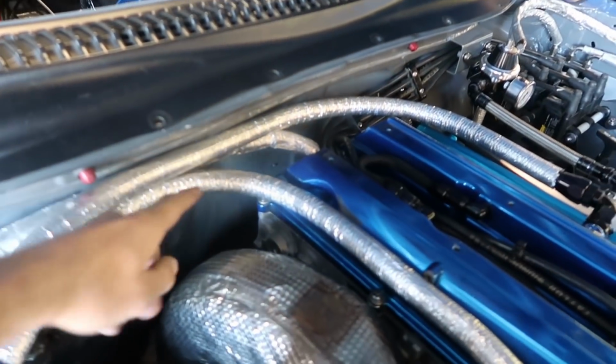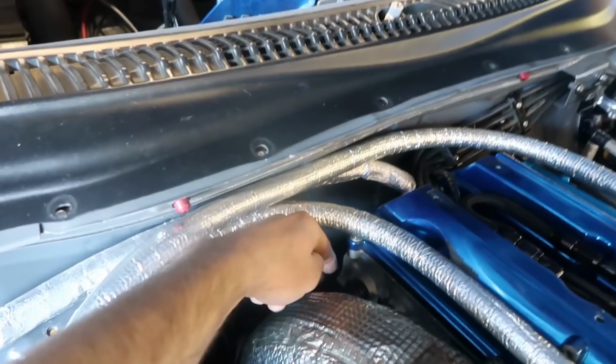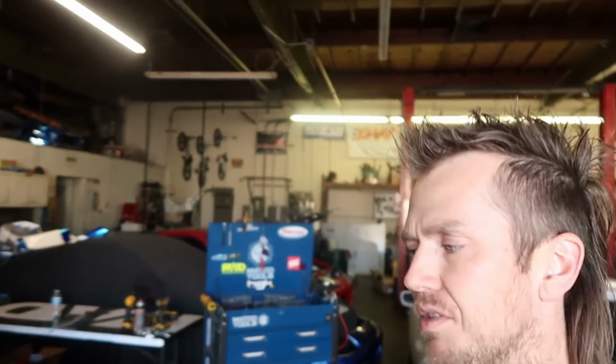TJ's was just kind of done how it was, and I had repositioned the back hose to go in the top of the head back there. I had just changed it from looping down in there to back there and eliminated that wraparound water pipe. I think you guys saw that a couple episodes back.